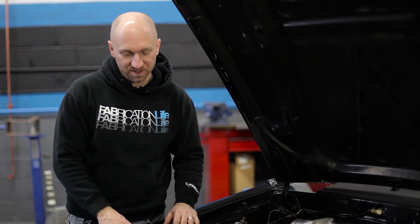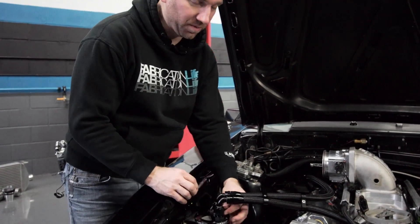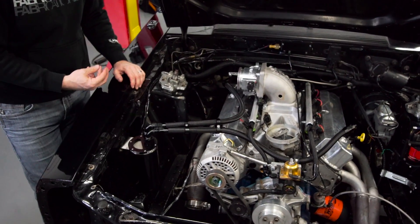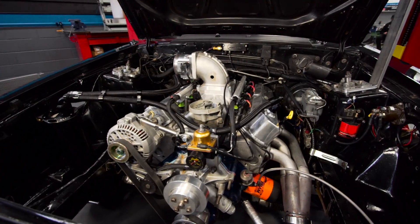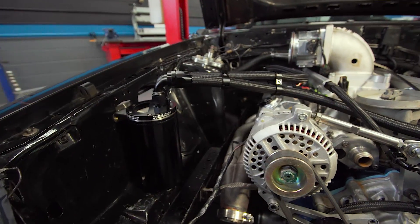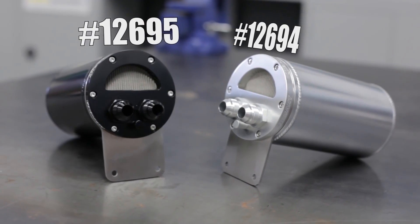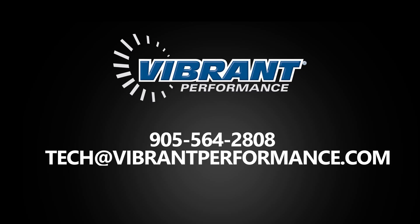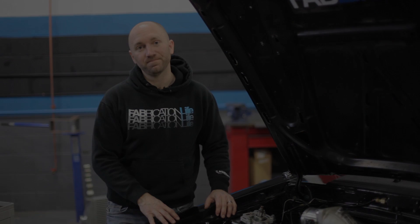I've just finished installing our catch can setup on this car. We still have access to our oil dipstick so we can check the oil level. If there's any oil showing up on there, we're going to want to drain the tank from the fitting in the bottom. We've added a hole inside the fender so we have access to that drain plug and we don't have to pull this tank out to drain the oil — it'll keep things simple at the track. This concludes our installation of Vibrant's open loop style catch can. Every catch can includes detailed instructions outlining best practices with easy-to-follow diagrams for both our open and closed loop catch can designs. If you have any questions, please don't hesitate to contact us — the only bad question is the one that isn't asked. Thank you for watching and be sure to subscribe to our channel so you don't miss any new content or installation videos such as this one.